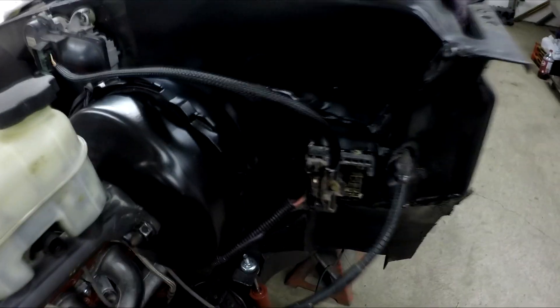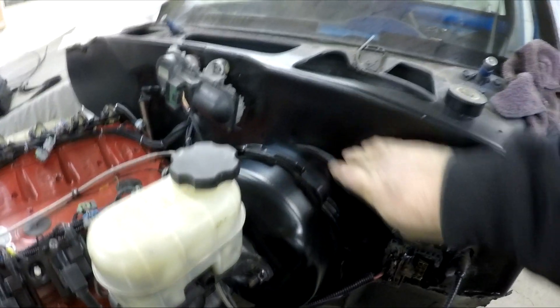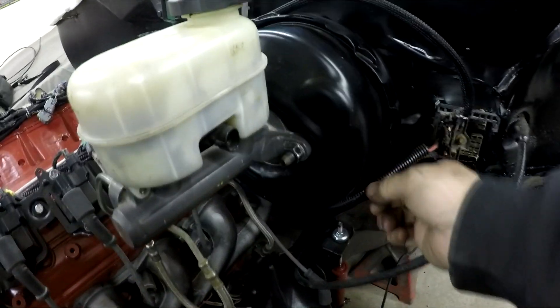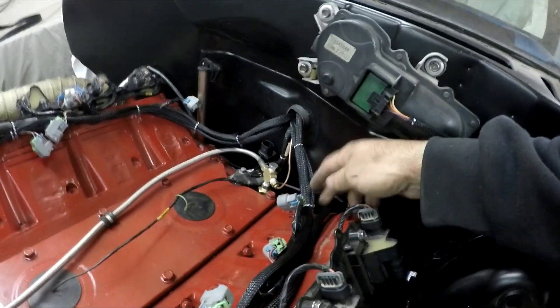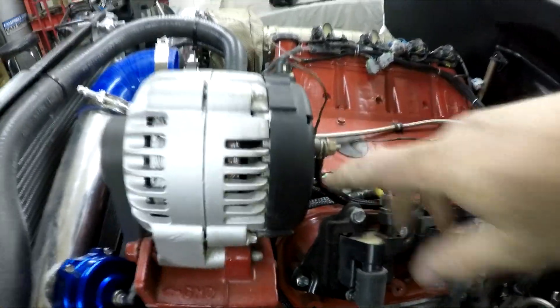I got those wires sorted - the wiper wire will tuck down once the inner fender is on. One wire goes down to the starter and the other two go to the alternator. The only thing I just realized is I must be missing a wire, because there has to be a wire going from the alternator to the starter to energize the alternator and also power the stuff inside the truck. I guess it must have been a separate wire, so I have to find and run a wire from the alternator to the starter.